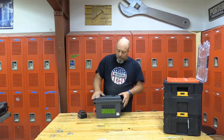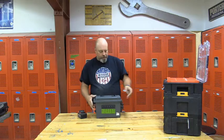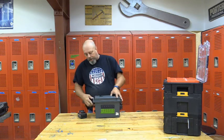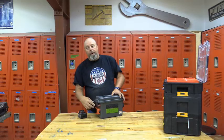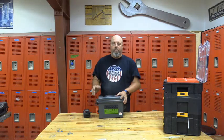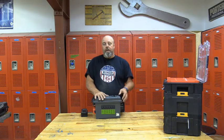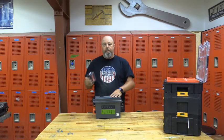What would I change? Not a lot on the inside. For logical thinking, I should have put the two 12-volt posts on this side, since that side is the 18-volt and this side is the 12-volt. The point of the two posts — they're optional — is when you're wiring a brand-new trailer without the plug hooked up, you can attach alligator clips or a ring terminal and still have 12-volt power running off your Milwaukee battery. They make adapters for DeWalts and for the 12-volt Milwaukee. On second thought, this could also be used to power work lights on the inside of a cargo trailer, with the low-voltage shutoff ensuring you don't damage your battery beyond recharging.